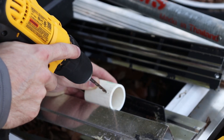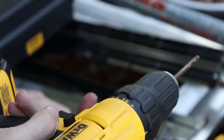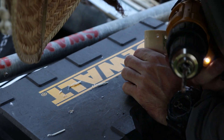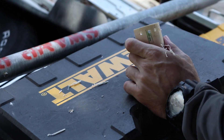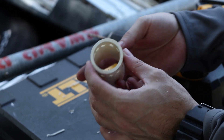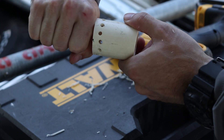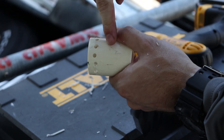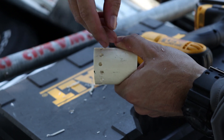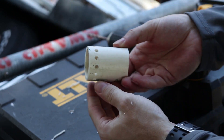I got a small one and a large one - we'll see which one benefits more. This will probably be the straight-hole one and then the longer one will have the angled holes. So this one will have straight holes. Make them symmetrical. Finished product - not the straightest holes, but for what we're going to be using it for, perfect. This will be the shaft side, this will be the prop side. Slide it onto the shaft then put your prop on. Your bushing is going to be right in here - this is the space between the prop and inside is going to be your bushing. Water is going to flow through here and get to your bushing, and grass shouldn't be able to collect because it doesn't have anything to grab - it just spins.